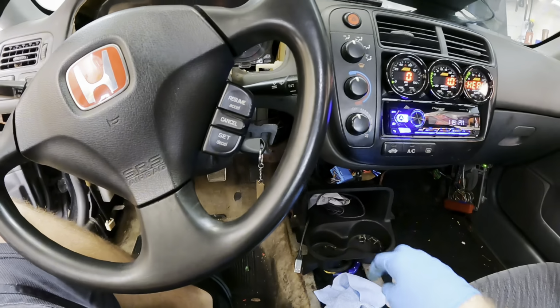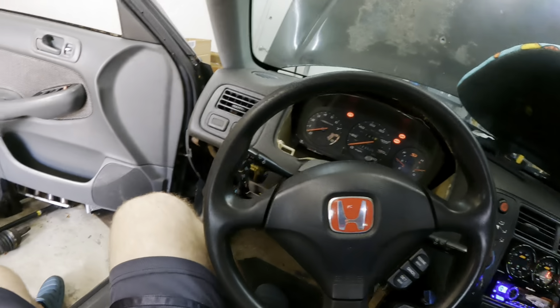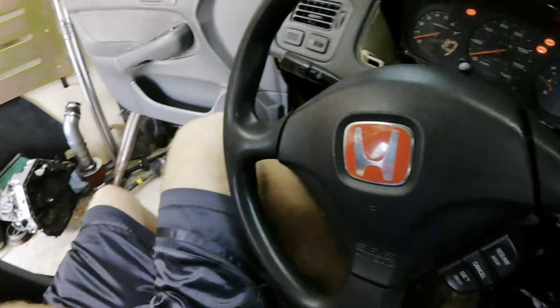I still need to do the fuel pump in this car, and I need to do the fuel pump relay before we do really anything else, but first I want to get that downpipe taken off once it's cooled down and do my little inspection there and see. I'm 90% sure that it's the oil coming through the exhaust. When I first started, it wasn't smoking so bad, and then it just started smoking, and I can't imagine it being the motor, especially after just doing mine and it not even smoking at all. And I did the same exact thing on his that I did on mine.